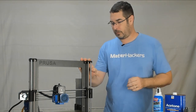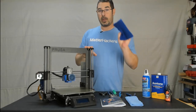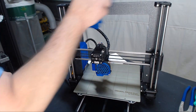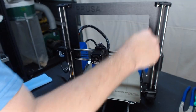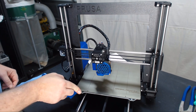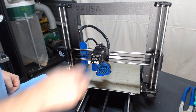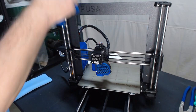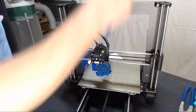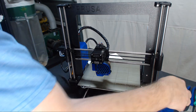So with that, let's start off with the first item: basic cleaning. All that it takes is a rag, and you just want to wipe down the printer and get the dust off of it, any little wispy shards or anything that come from stray prints. You also want to pay attention to your rods. You'll notice that it builds up hair along the rods, and you're going to want to brush that off as well. Hair or dust build up on the rods on each axis.